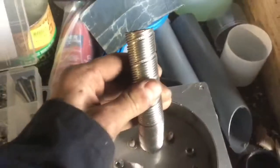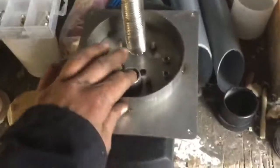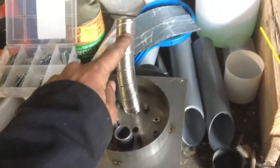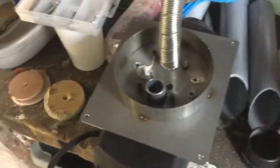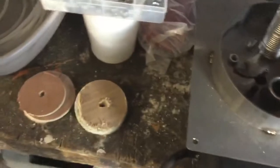It's worth working out which angle you want the pipe to face, as once it's bolted on and under the van, you don't really want to be bending these pipe joints — it will break. As you come to get your old pipe off, what you might find is that it unravels like this, so it might be worth cutting it if it's an old pipe and then saving a section you could use. I was lucky I had a new bit of pipe lying around, so I can just use that.